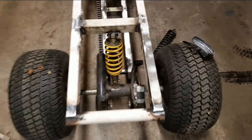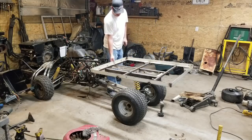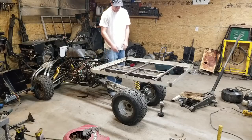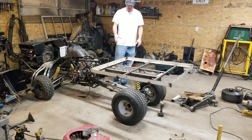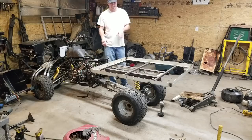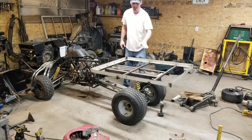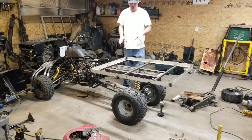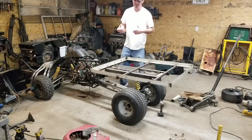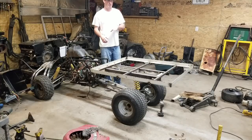As things usually go when you're working on something, you plan something out and things change. Quick change up — we're not going to be using the double shocks; in fact we're not going to use one of those shocks at all. I had mentioned that I didn't like how these weren't adjustable. Well, I've got this shock up in there — I don't have it welded yet, I've got the top tab on there and got it sitting up against that cross frame right there. I've realized this thing has a lot of spring on it, and if I need it to be stiffer I can adjust that. I've got this adjusted as loose as it will be, so all I've got to do is turn this bottom one, which will put more tension on the spring and hold more weight. So I think we're gonna leave it right here and just weld this in.